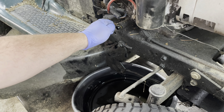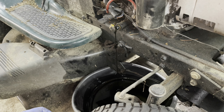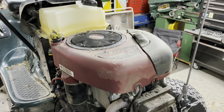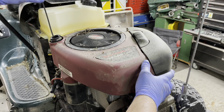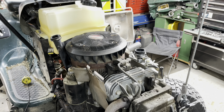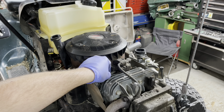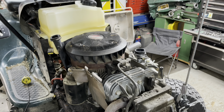Can't wait to see how thin this is. Comes shooting out like that when it's ice cold — you know it's thin. Beautiful. Let's get that drain off and probably get this cover off. Let's see what mysteries lie underneath — I honestly don't think it's going to be bad because I didn't see mouse house poking out. But I also know somebody's been here. And gorgeous — no mice. But the question remains: why did somebody disconnect the kill wire? The tab is right here. Maybe it lost spark? I don't know. I'm going to leave it hooked up for now, and once this is done draining, I'm going to put some fresh oil in it, put a new battery in, and finally start seeing whether it cranks or what.